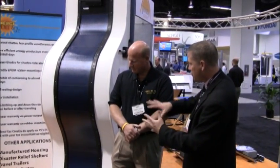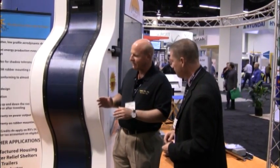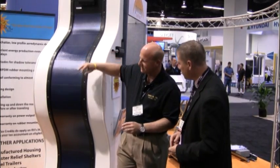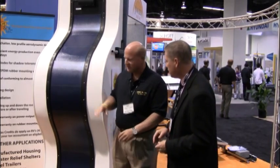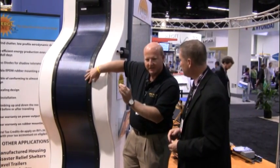Does this stick on the roof, and how do you keep it on? It has a 2mm EPDM mat with an adhesive process on the back that sticks to the top of the RV. Then you take the rimming process — the way we have it designed, it locks in so you don't have to use any silicones or anything else, and you won't get any leaks. It doesn't leak because it actually forms its own gasket. When you put pressure from the top, they all come together like a gasket, and it's been highly tested.